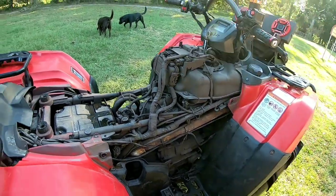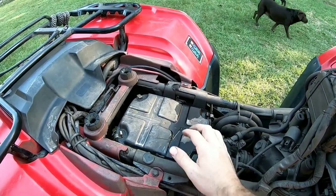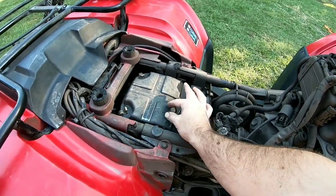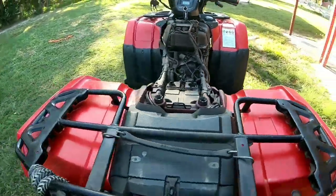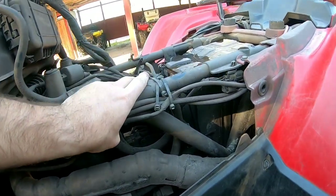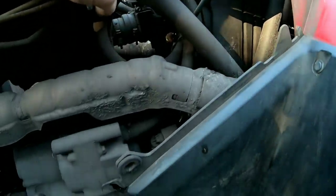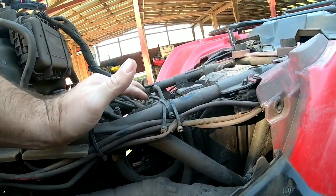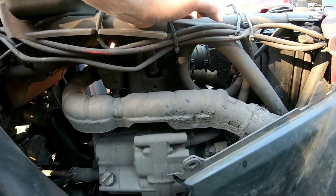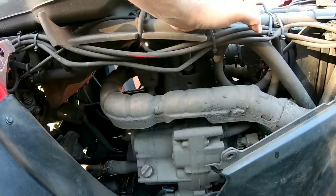In the Rancher air box I have an Outsider's Mud Crew air box lid gasket — you can find that at outsidersmudcrew.com. Another one of my mods that's been getting really popular is the crankcase mod: you put a half-inch hose from the air box to the crankcase. That loop puts air higher than the air box so you don't get milky oil. Even if you submerge your air box and get water on top of the piston, your oil stays protected so you can ride for the rest of the day.